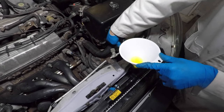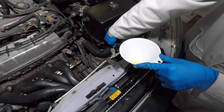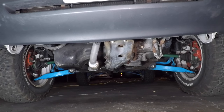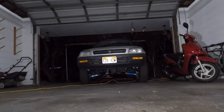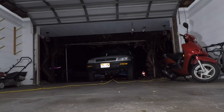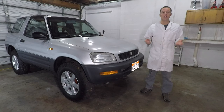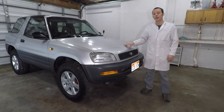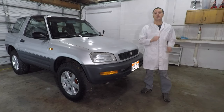I filled the overflow to the full mark and the radiator all the way up. With the engine running, I'm squeezing the upper radiator hose to get the air out of it — I can get most of the air out of the system like this. With the engine running, look for leaks. I don't have any, so I'll go drive the car. I need to go long enough for the engine to warm up and the thermostat to open. Turn the heater on — when it blows hot, you can go back home. The test drive went well and I don't have any leaks. I'm letting the engine cool down a bit and then I'll double check the coolant level. And that's it — I'll see you guys in the next video.